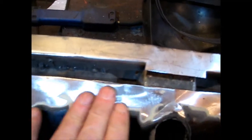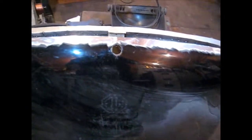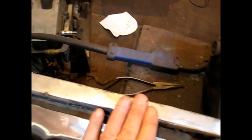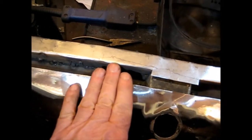A little bit further forward — I've cleaned this edge up here back to bright metal. This is the original MGB boot lid edge and I've cut the old rusty pieces off. I've welded this new piece in. That's the new piece that I've let in that the skin fastens to. The skin I'm putting on now welds to this and goes over the top and then curls over the back. Now I was going to make a new piece.